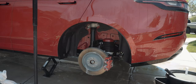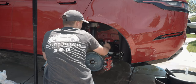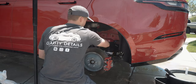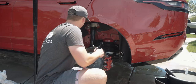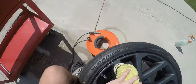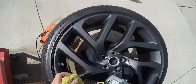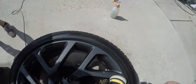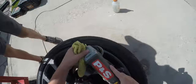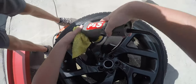On the brake calipers we actually used a little bit of Iron Buster — because obviously there's brake dust on them. They're the brake calipers, so clearly you're going to have some iron on there, because that's what brake dust is — little flakes of iron. After cleaning the wheel wells while they're drying, we're going to coat the actual wheels. Then after the wheels are coated, we're going to coat the caliper. It's nice to work efficiently — while the wheels are drying, clean the wheel wells; while the wheel wells are drying, coat the wheels.